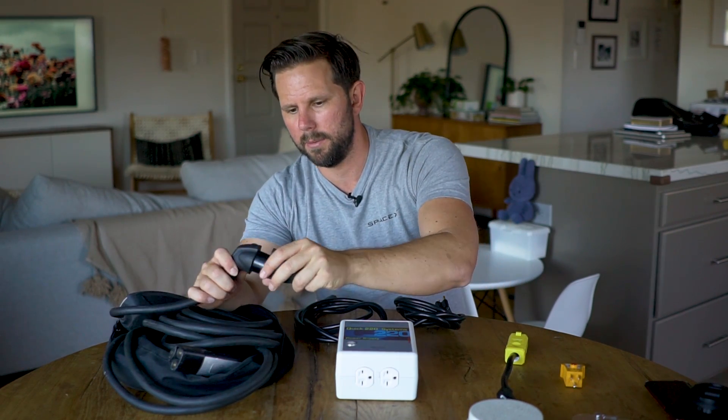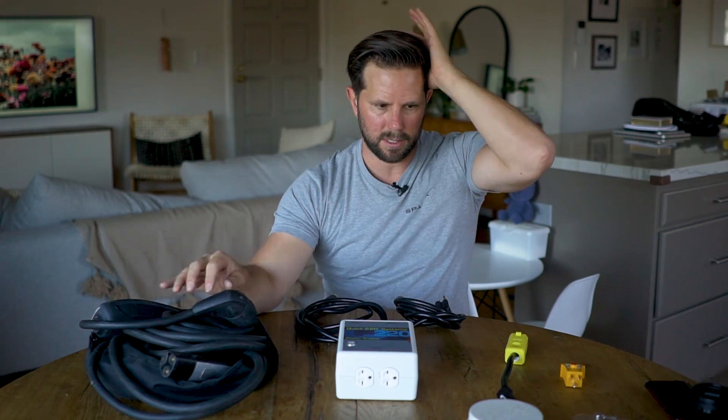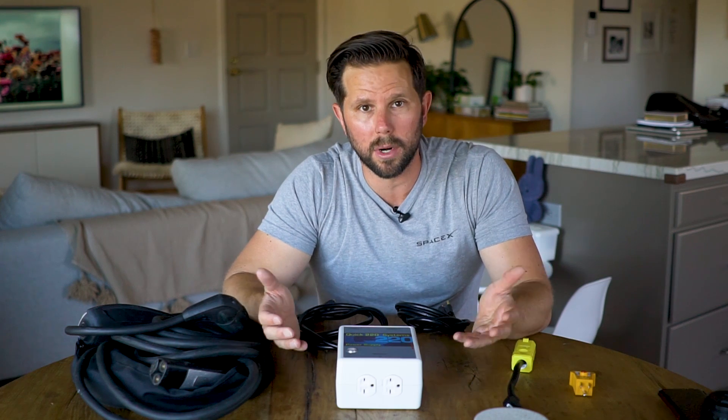And then your universal mobile connector — the portable charger from Tesla that you'll get when you buy the car — with the regular 120-volt outlet adapter. This is one of the older models. If you have a newer Model 3, or even one of the newer things where this whole unit comes out, it looks a little bit different, but it's the same thing. So if you get it from Tesla, you'll have it. Try to make sure you're not plugging into an outlet or a circuit where the refrigerator is connected, because that could come on randomly and then you're already pulling a ton of power. You could pop that circuit, the fridge would stop running, your food would go bad, and your charging would stop altogether. So it's one of those things where you'd have to be a little bit more cautious about what you're doing there.